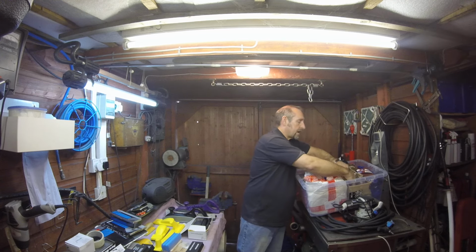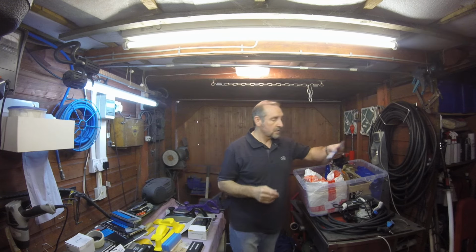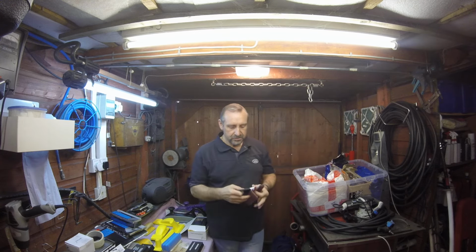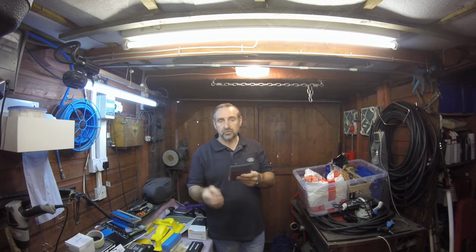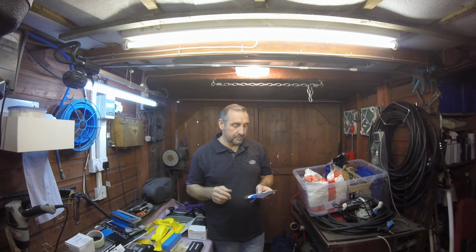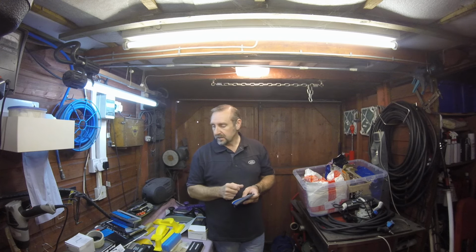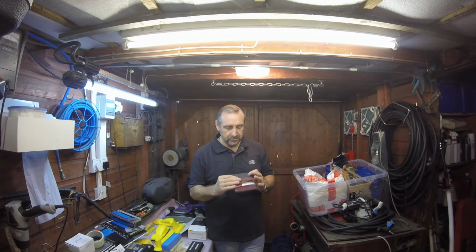Grey Scotch pads are finer cut than red. So blend areas where you think the paint finish might be affected, use the grey Scotch pad. That's your blend area. I also use the 3M buff and blend material. It's like a cutting paste that you put on there as well. That always just lubricates the pad a bit better and does a better job. Does a nice smooth job.